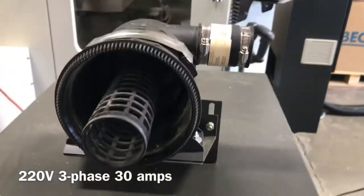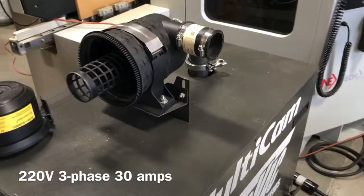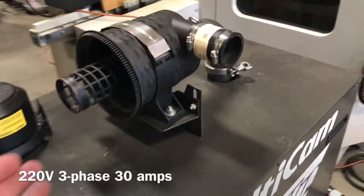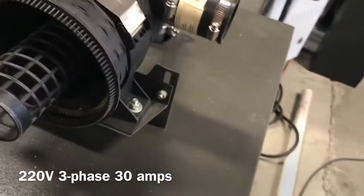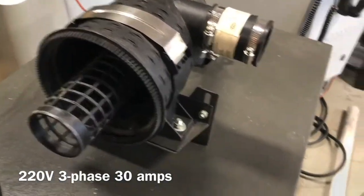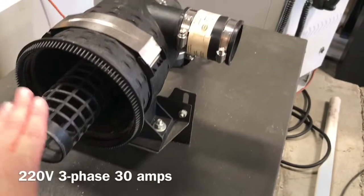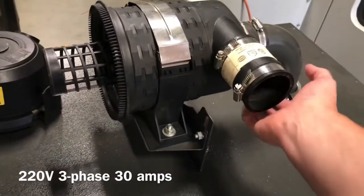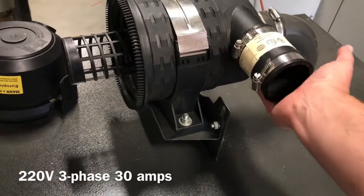The reason we do that is because if we power this thing up and it is blowing air instead of sucking air in, it would want to blow that filter out and could possibly damage your plastic top. We don't want to do that. With the cover and the filter out, we're going to leave this open so we can feel if this is blowing or sucking air in.